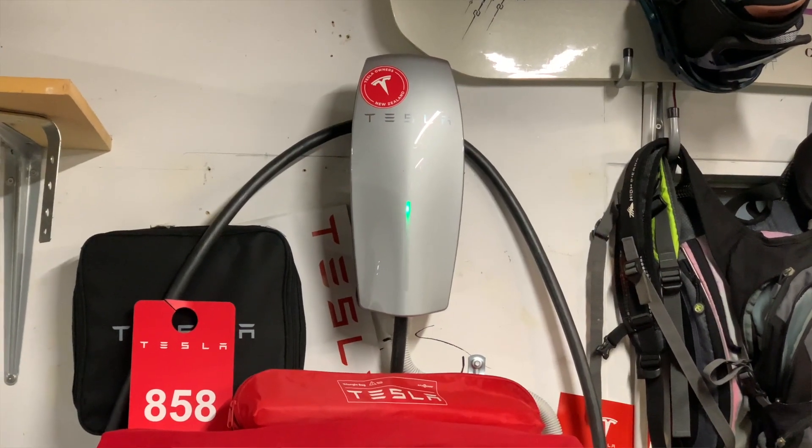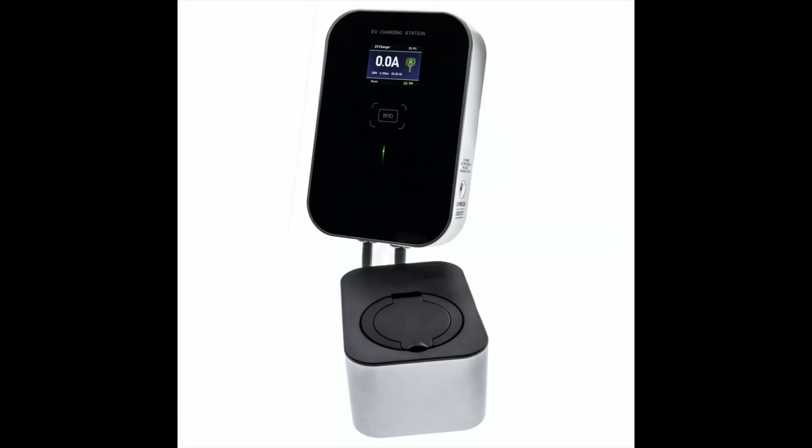You can also install a wall unit, a bit like this one from Tesla. This is a tethered unit, but we recommend one with removable cables so you can use them with any electric car. If I want to charge my Leaf on this, I can't because the plugs are not compatible. And most Leafs won't charge any faster on a dedicated wall unit, as they can only accept about half what is offered, making these pretty poor value for most Leafs.